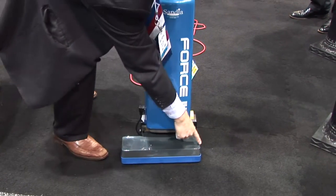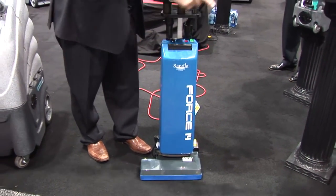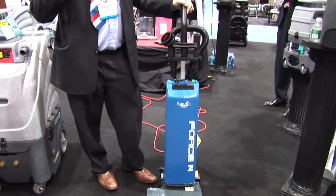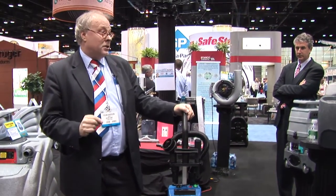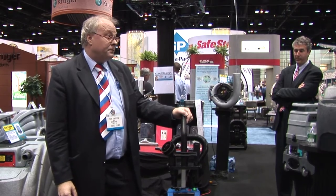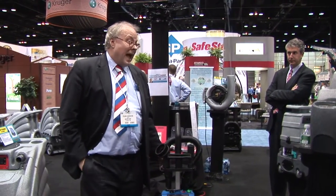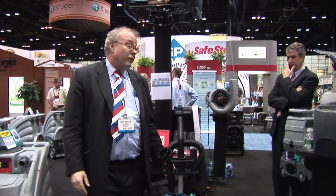How have we done that? We've done it by making one solid piece of steel going through the brush roll — that's where the center of your working is. There is a solid metal piece in it, and then we have two shielded ball bearings on the sides. That reduces vibration and gives you the maximum load onto your floor.